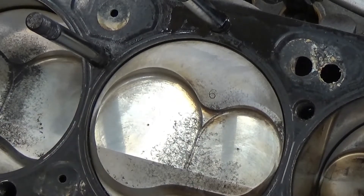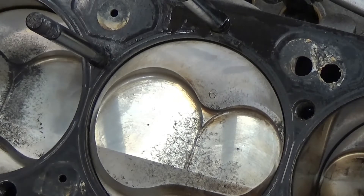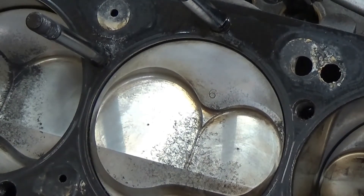I'm sure blessed that that's all the problem is. We'll get this stuff cleaned up and get with Randy and get another head gasket, intake gasket, and we can put this thing back together. We need a rocker or a pair — he said he may have some one-point-sixty-fives, while mine are one-point-sevens.